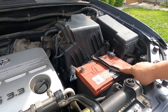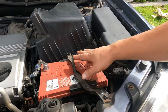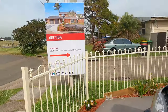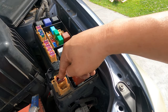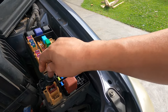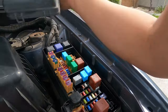Yesterday on Sunday the car was very flat and they tried to jump-start it but put the battery in the wrong way. When they started it up, smoke went everywhere in the fuse box. I came and checked — it's near Bang Sao Airport so very noisy. They burned the fuse. What you can do is push the fuse down to make it work, but for more power, we need to go direct power from the fuse box straight to the battery — that will be safe.